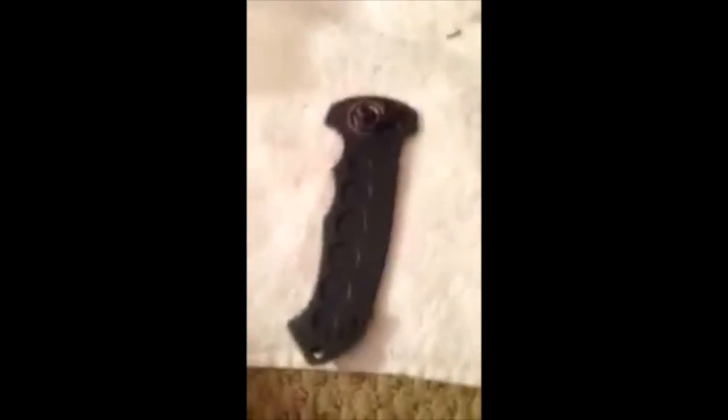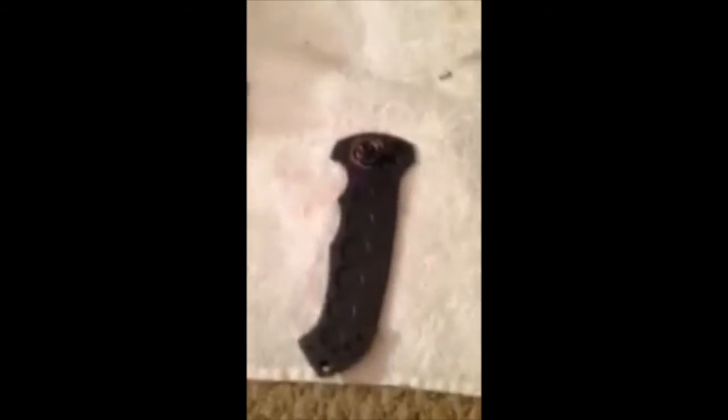So I'm just going to go ahead and take the small screws and put them in this handle right here to stick that whole thing back together. Just be careful that the spring doesn't come out. If it comes out, it's alright, just put it back in. Just make sure that the pin that retains it, which is just underneath the inner shell, that's what I'm going to call it, is just sticking out just a little bit, just like that. And I'm going to go ahead and put those screws in.